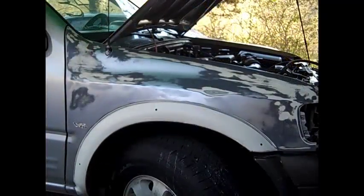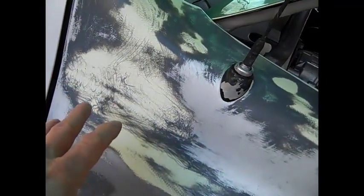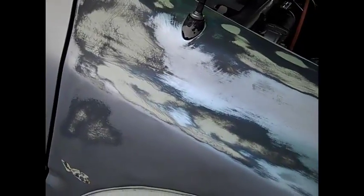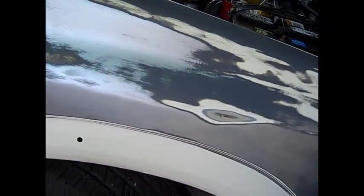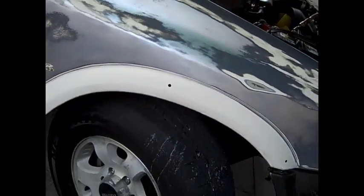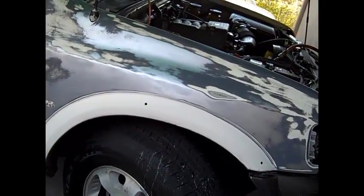Look at this — instead of sanding it, they ran some sort of grinder over the paint. It's sad to say, but all you've got to do if you're just going to put a coat of paint on something is scuff it using an abrasive scuff pad — a 3M Scotch-Brite pad — wipe it down good, and paint it. All this extra grinding and these swirl cut marks means I'll have to grind a little bit of metal down and put a little filler over that to get the edge back out right. So much for a quick job, although it still ended up being pretty quick. I'll put a coat of primer over this whole fender, and then if it comes out smooth enough I'll scuff it down; if not I'll block it down — I'll probably just block it down to make sure all those scratches are gone.